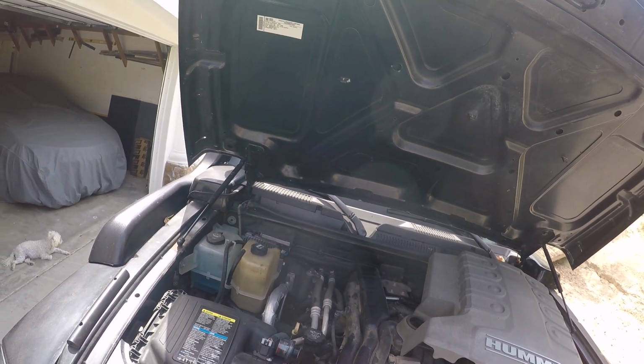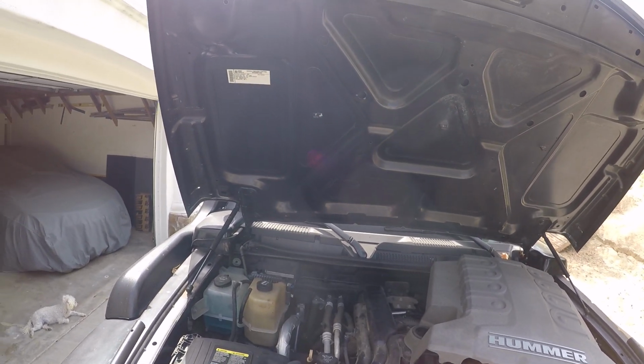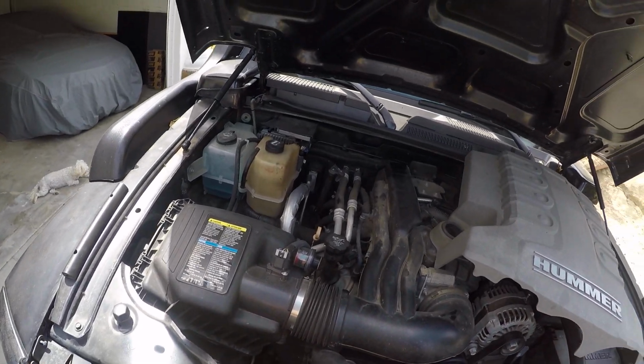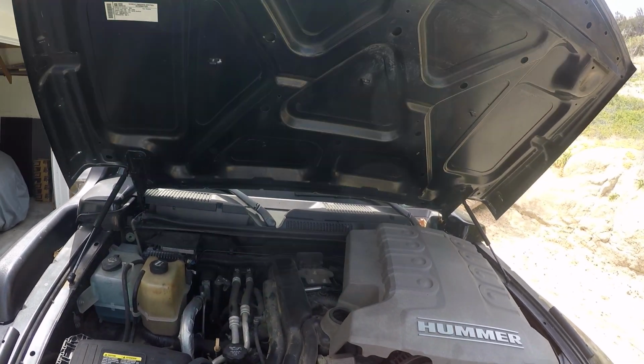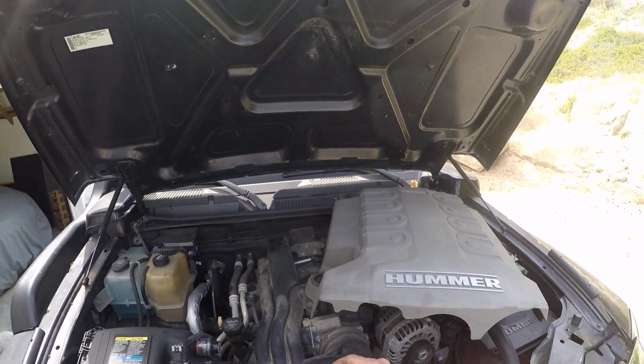In America, we use psi because we speak American. But in this case, 13 to 13 is very easy. So I'm looking at my tester, and I'm just going to go ahead and start pumping it. Ultimately, what I would try to do is pressurize the system to no more than what it's rated for. So if it's rated for 13, I'll probably go right for 13.